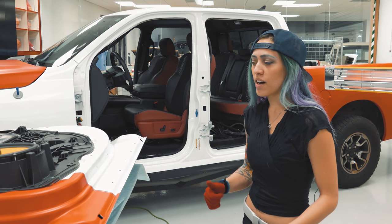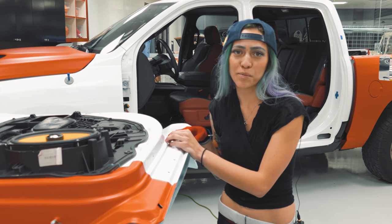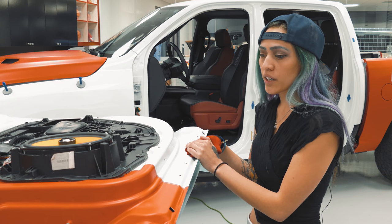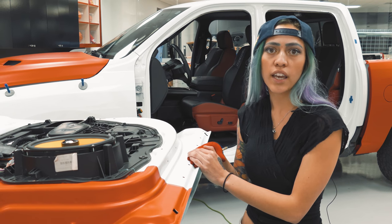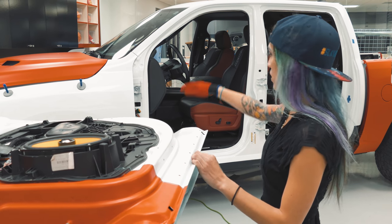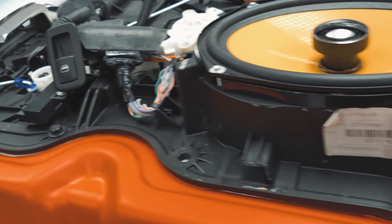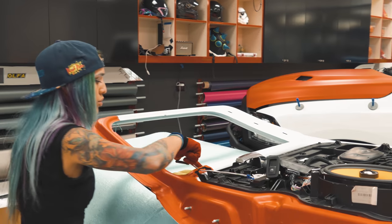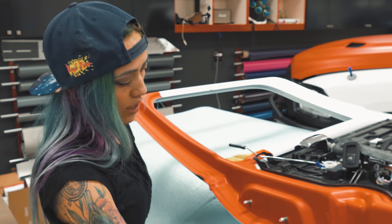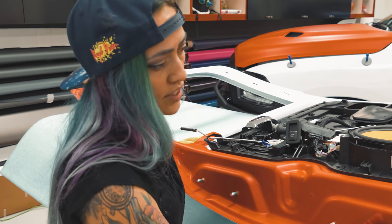All right, so door interior panels. Let's talk about these. These are like the hardest part when you do door jams, in my opinion. So we're gonna actually be doing these ones in two piece. Occasionally we do them in one piece. It depends on the door. With these trucks, specifically this one, it's got this body line right here, if you come look up close, all the way up the line of the door. So we're just gonna seam it there and make it easy on ourselves. But this right here is all one piece. If you see, we pre-stretched it real nice and around.